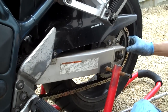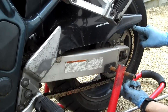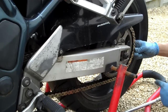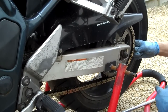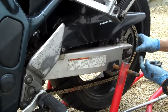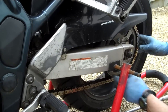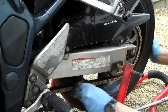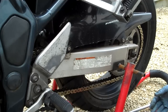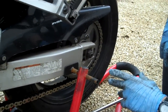To check whether a chain is worn, pull it off the back of the sprocket. Don't check at the adjuster because you can just adjust that. To check wear, pull it off the back — if you can pull it right off and get a screwdriver in there, it's knackered. Also check the teeth on the sprocket, which is very important. There you go — one clean chain. Now it's time to adjust it and get the tension correct.